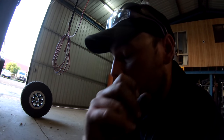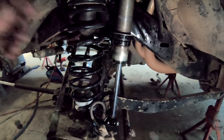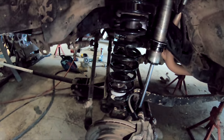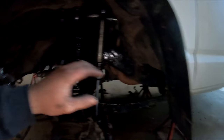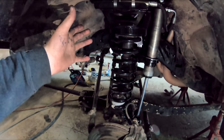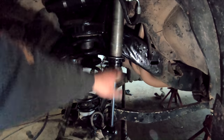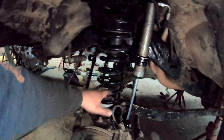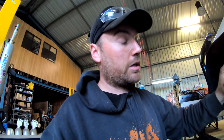Also, something I didn't mention in the last video - if you actually want to measure up shock lengths, what you could do is put your car on the bump stops. Say if you wanted to run 37s and space it to suit, what you'd do is jack your diff up, cut your guards to suit - usually just the back here and a little bit at the front - space your bump stop to suit the tyre. Then once you've sorted that out and you know there's plenty of clearance with the tyre, all you have to do is measure the eye to eye or pin to pin on the factory mounts - pin to pin length closed. That'll give you a closed length at bump stop, and then you just work out what shock works best with that bump stop spacing for your wheels.